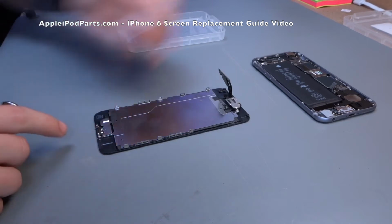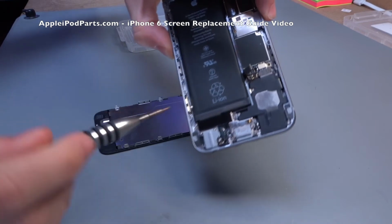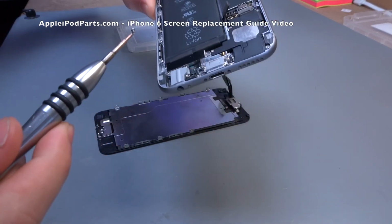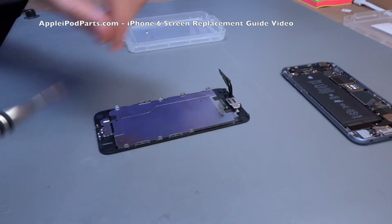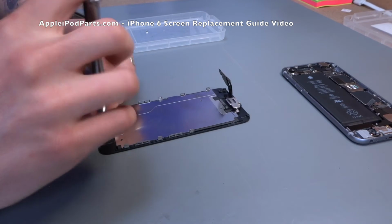And there's a screw missing here. Now this is a fascinating one. Damien picks up the rear casing, and sure enough, it's never been opened before. There's the screw. Now if you've got a screw that's missing in a hole that you know has never been opened before, have a look in the phone, because sometimes the vibration does do this. We see it way more often than you'd think, which is a bit scary considering it's waving around in those electronics.